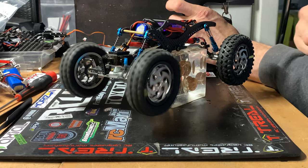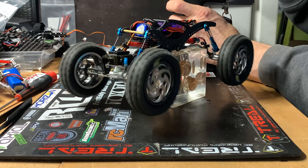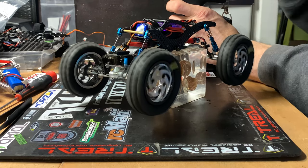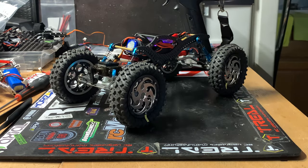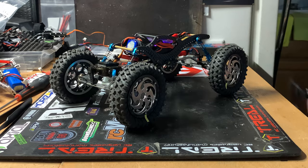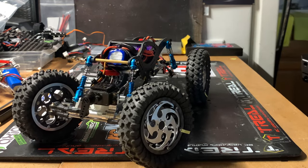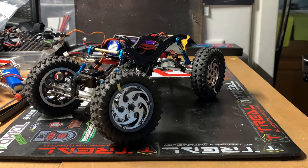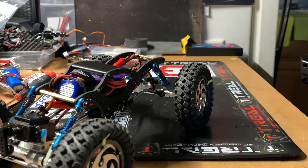In order for dig to work, you're going to want to back out of overdrive to the maximum amount and put that into the neutral speed, which is on your VR1 knob up on the top. Dig is pretty effective — I will say it works pretty sweet. The front axle on this definitely has a little bit more power than the rear, so it can push beyond it, but for the most part you can see what's happening.